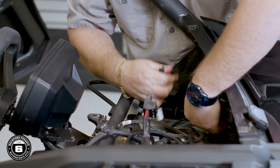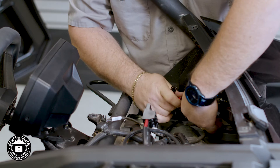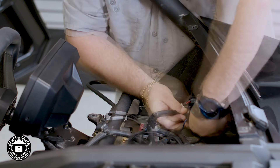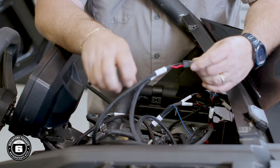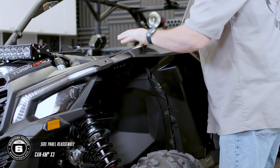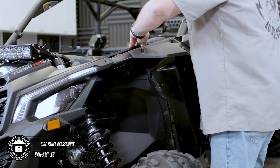Now you're ready to wire the amplifier. These new M5 series amplifiers are equipped with our new preset technology and also have new pigtails for your connections. Start with your output cables: your front output is for the dash panels, your rear output is for the moto cans, the sub output is for the subwoofers, and connect your power plug as well. Then move to the input — plug in the harness labeled front to the pigtail labeled front, and the harness labeled rear/subwoofer into the pigtail labeled subwoofer. Now that your amplifier is mounted and wired, you can reassemble your side panels. Be certain the lower tab on the bracket is seated over the panel screw on the front firewall and secure the provided 10mm nut. Then go ahead and tighten down the seat clamps.